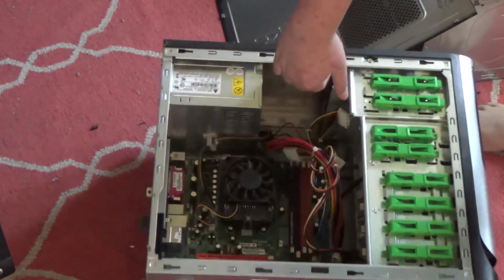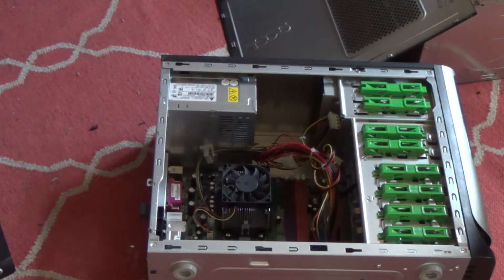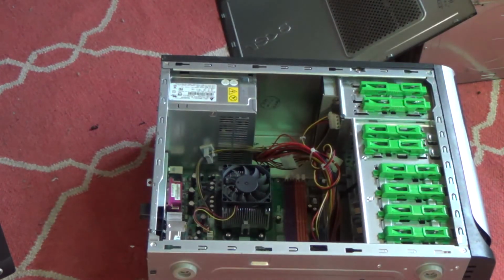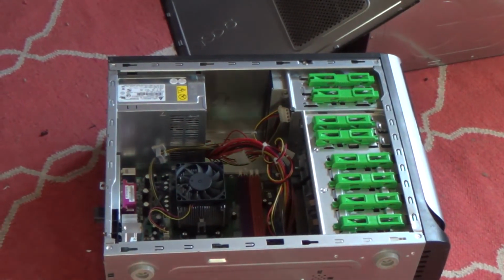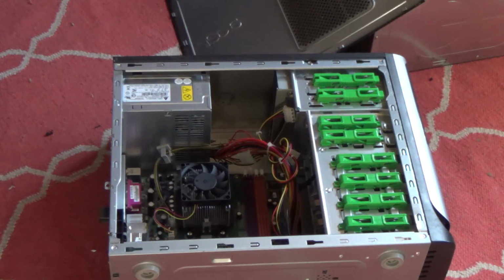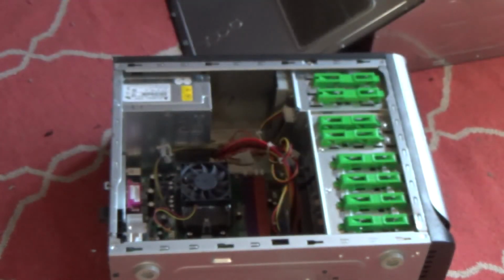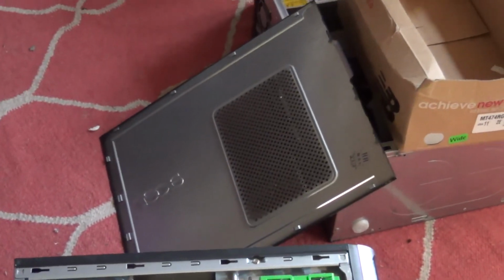It has some RAM, which, here's what's stupid. Oh no, somebody took off with the other RAM stick in here. That's kind of interesting. I was going to say this is how much Microsoft set up the Vista platform to fail, because they had 1 gig of RAM in here, single channel. This is DDR, I think DDR2. Yeah, it is DDR2. Running in single channel, the performance would have been terrible. But this is DDR2 512 meg, so there's only half a gig in here. There's no hard drive, so I have no idea what they were running on this, but I sure hope it wasn't Vista.